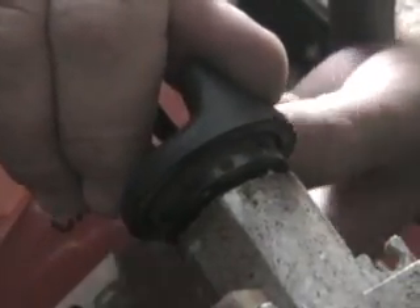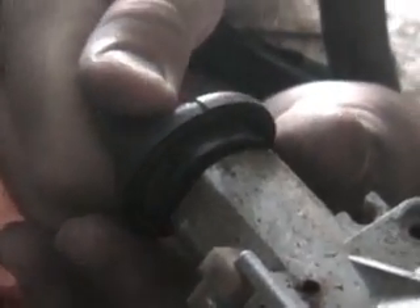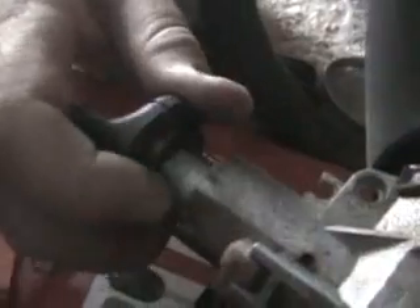Okay, then I pull the tension rod and turn it a little bit. And then I get this key that's cut all the way on both sides — the deepest cuts you could make in the key all across on both sides. You stick it in and that'll release; there's a little booby trap or a little catch in it. Then you can turn it forward, put the car into neutral — otherwise it'll start. Unless you're stealing the car, then you want it to start. But in our case, we're just trying to take it apart to make a key for it. Turn it all the way on, put this pick in there, push on the button that's in there and rotate it back, pull the pick out and pull the cylinder out just like that. Cylinder's out.